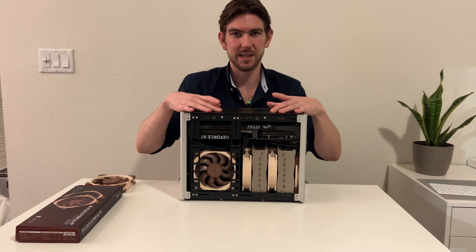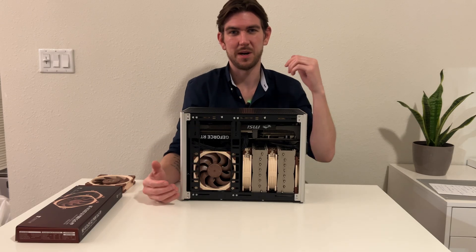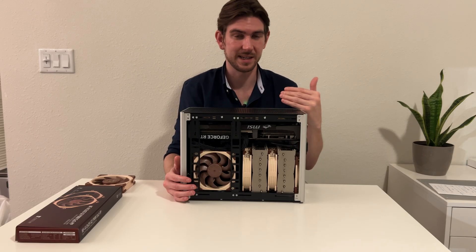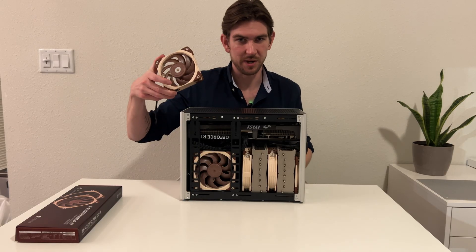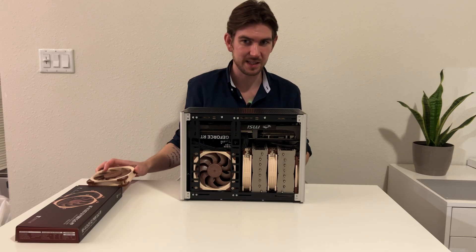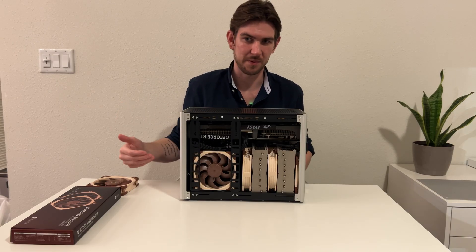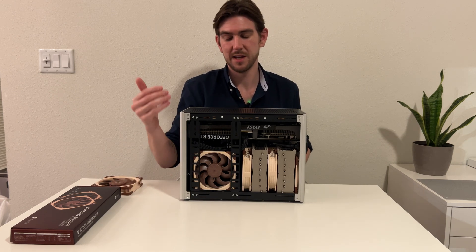Because I added these extra fans, it reduced GPU temperatures quite a bit and I haven't really noticed a difference swapping it around. In terms of hardware, I have a 9950X3D — I have not undervolted it at all, I want to stress that — on an X870 Gigabyte board. I ran Timespy Extreme: first test to warm everything up, and the second test is the reading I took. With the original fans, even though they spin at a higher RPM, the temperature was 75 Celsius for the CPU.